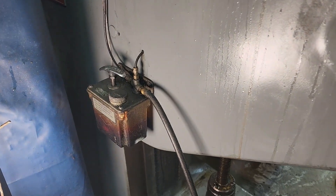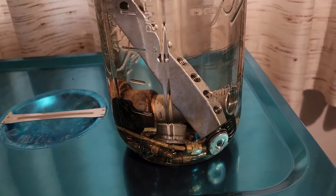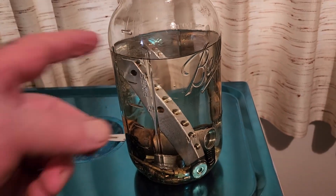The remainder can just be cleaned and all of that is going to come apart and get put in the ultrasonic cleaner as well. The parts are in there and this is in a nearly pure alcohol solution — this is military grade isopropyl alcohol, there's nearly no water in that at all. I'm going to be doing this at room temperature because a hot bath could create a problem — it could evaporate and build pressure.